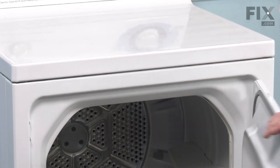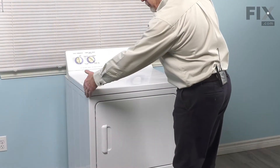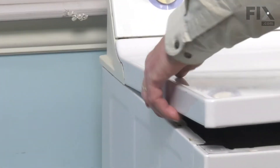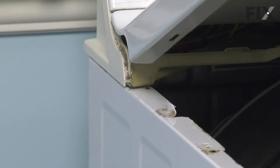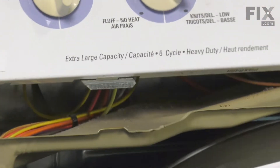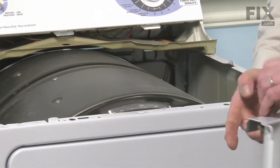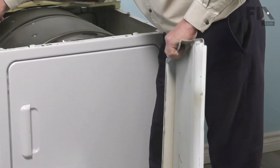Once we remove those, we can close the door up and then we'll remove the top. Just lift up on the front of the top, pull it slightly forward, and then hinge it from the back where it connects to the top of the side panels. Once you pull that free, just tilt it up a little further, and that will remove it from the three tabs attached to the console. They fit into three slots across the back of that top, and these two portions on the main top tuck underneath here.